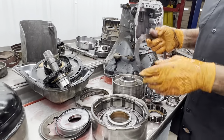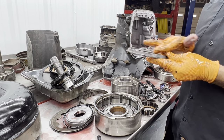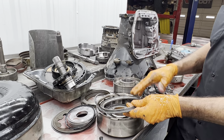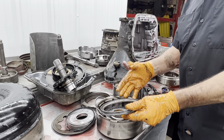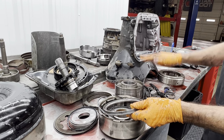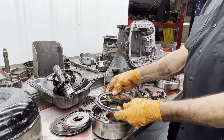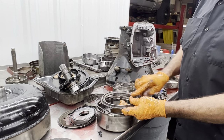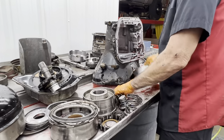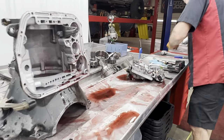Once we do that, we can add another clutch and a steel. But you got to have another one of these, and you just got to take that down a little bit. Once we do take this down, we put the drums together on the pump, flip it over, air check the third gear drum, and we make dang sure that it doesn't lift up on anything. When I air check it, nothing moves. If it lifts up on something, that tells you that you haven't cut this down far enough yet. Okay? There's so much to know on these trannies to make it work.